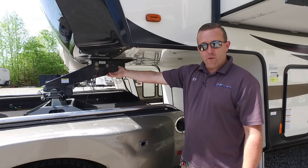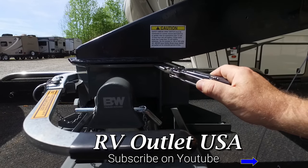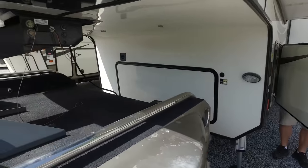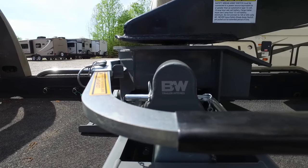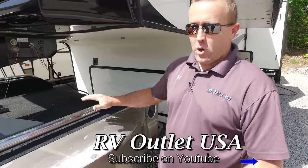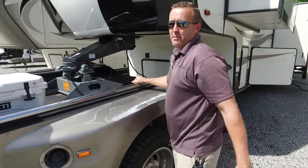What you actually want to do is take the weight off of the truck. As we jack it up, watch right here where the hitch head and the kingpin plate meet each other. Raise the unit up until you see a relief — a small gap there — that lets you know the weight is off of the truck. Once you see that relief, set it right back down on the head. At this point there's no weight on the truck, so when I unlatch, open my handle, and pull out, it won't unload itself. My latch is open, so I'm going to pull away.